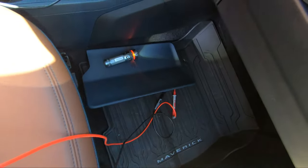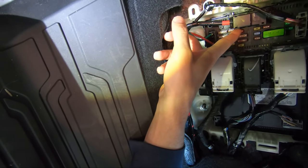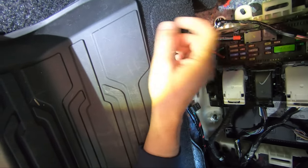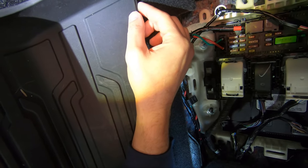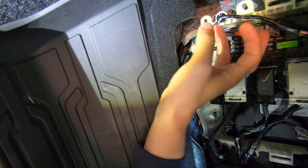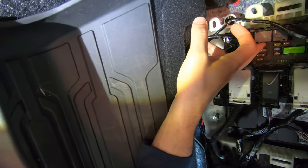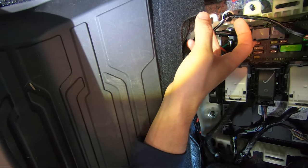This is something I've been meaning to do. I wanted to test some of these fuses that people are often tapping. This one and that other 10 amp fuse there. They can only be mounted with a fuse tap in one direction because of the surrounding pieces of plastic around them. So I wanted to see actually which leg was line versus load, because that impacts the orientation of your fuse tap.